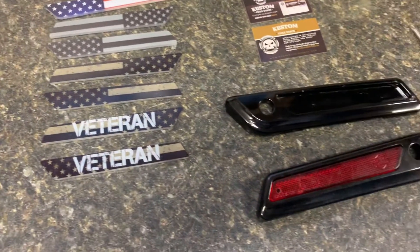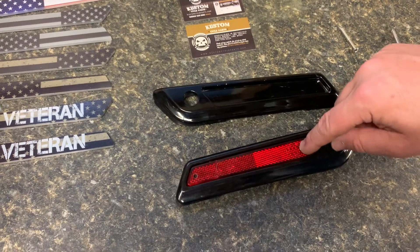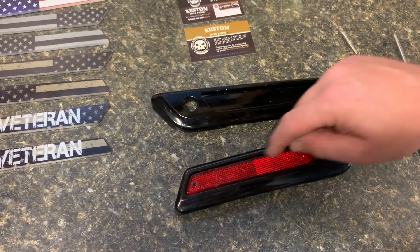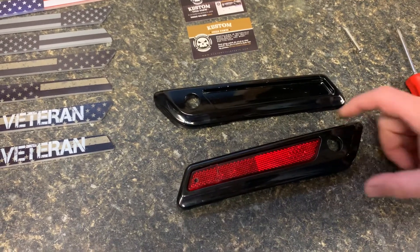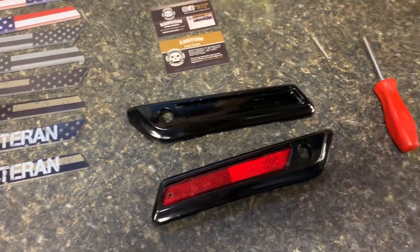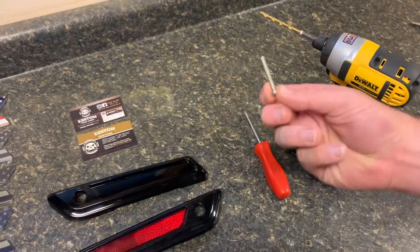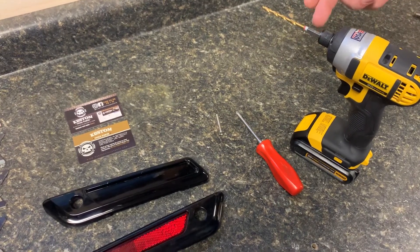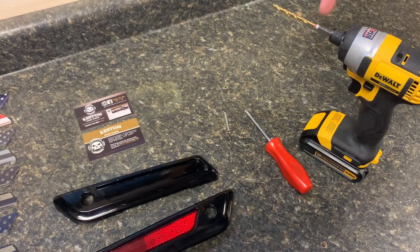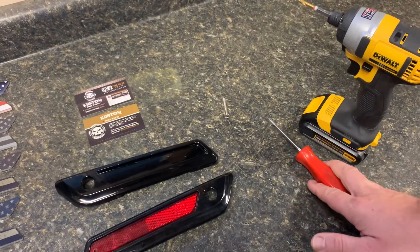The main reason for this video is I wanted to show a quick and easy way to remove these reflectors without scratching or damaging the outside of the actual metal insert. The tools you will need are just a simple drill with a drill bit, a screw that is a little bit smaller than the actual drill bit. In this case we use an 11/64 drill bit and then a number 10 screw, and then just a screwdriver.